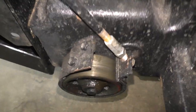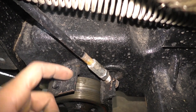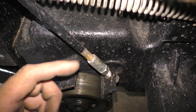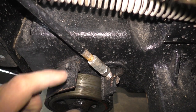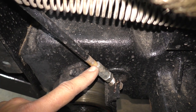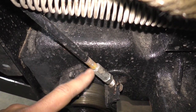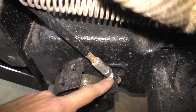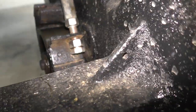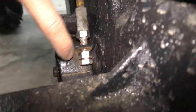The only other thing I had to do was the brakes. All I did was get one of these — I don't even know what they're called — basically a real long joiner nut. I threaded it on halfway onto the existing brake rod, then I just put a 3/8" bolt through the other side with a nut on it to adjust it. That's all I had to do with the brakes.